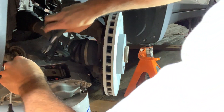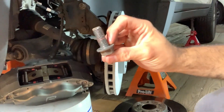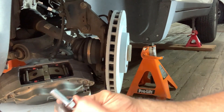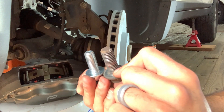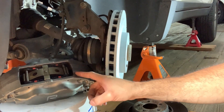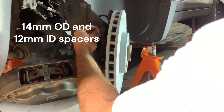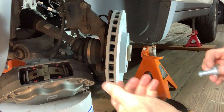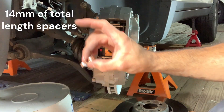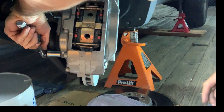I'm going to clip this wire because it's not needed on my car. Here are the stock bolts that go with that caliper — these are 14 millimeter bolts, and then these replacement ones are 12 millimeter, slightly smaller. The through-holes are here, and the tapped holes are in the caliper. I have these one-millimeter spacers to put in there so they fit tight and keep from rocking around — a mix of narrow and wide spacers with grade-rated fasteners.